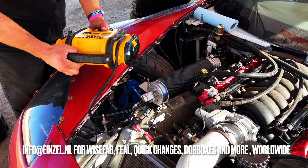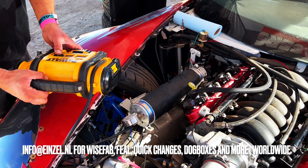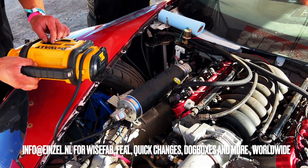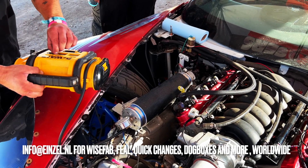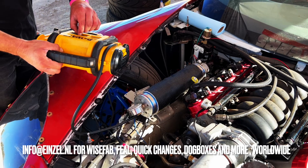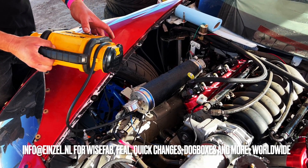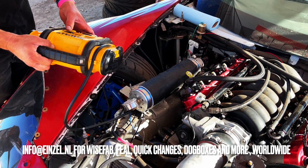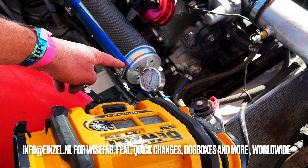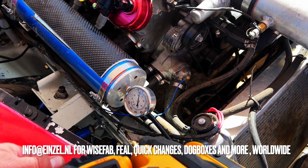Whether it's a first install or an oil change, this is what you do first: you hook up the Schrader valve to an air compressor and set it to 60 psi. There's a piston inside that blue canister and it will move all the way to the far end, which is the oil end — close to the bulkhead on our car. The air end is close to the headlight, so putting 60 psi on there pushes the cylinder and all the fluid out.